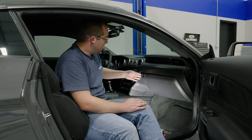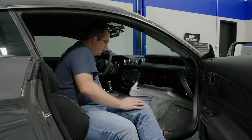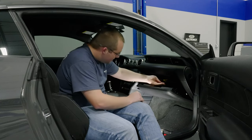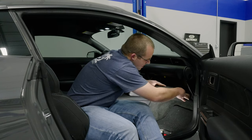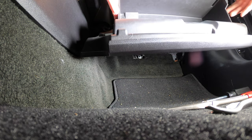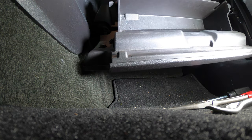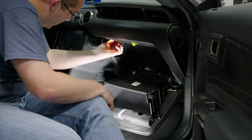All right, last but not least, the glove box light. Go ahead and open up the glove box. Take your belongings out. Got the manual up here. You take that out. In order to get some more access here, on the right-hand side, you pull up, pull that out, and you push up a little bit. You can pull this whole thing down. On either side, you can see where this pushes in the little bumpers here. Anyways, this gives you access to the factory incandescent glove box light.